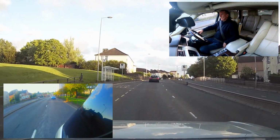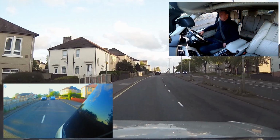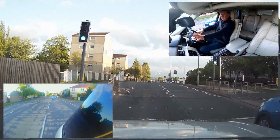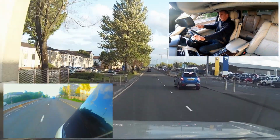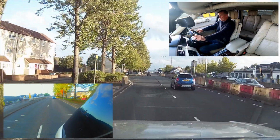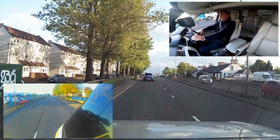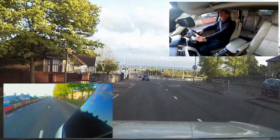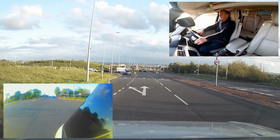So let's hope there's nobody behind us and we'll get that usual puff of white smoke or blue smoke coming out the back of a Range Rover as it starts to accelerate, and blind the people behind us. I haven't got the gap tool connected to look at the parameters. I'll do that, I think, once I've run the car and put my atomizer in it to try and clear a lot of the soot and carbon out of the intake manifold. Then we'll put the atomizing material in there, and I'll make a video of me doing that. Hopefully we may see a difference in the air intake volume and the air intake pressure. Don't expect to see a difference in the air intake temperature because it's always cold here in Scotland.